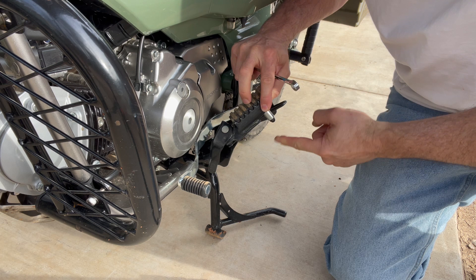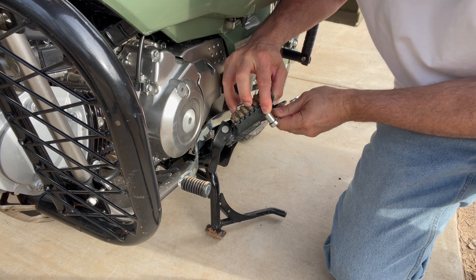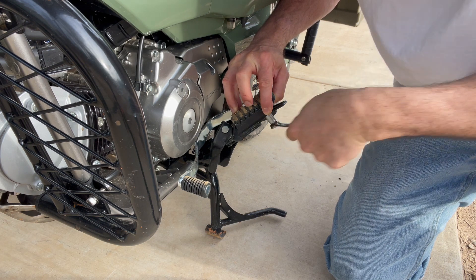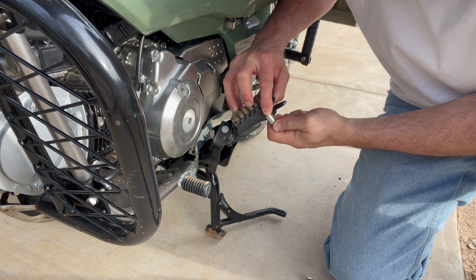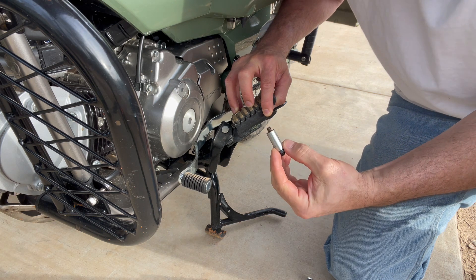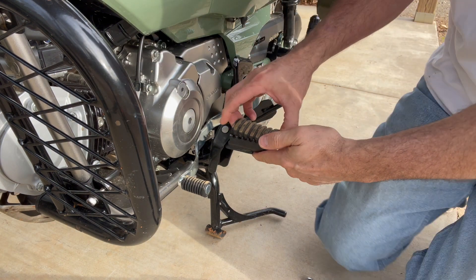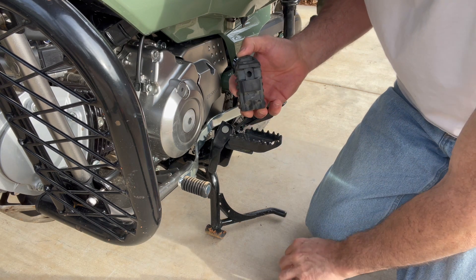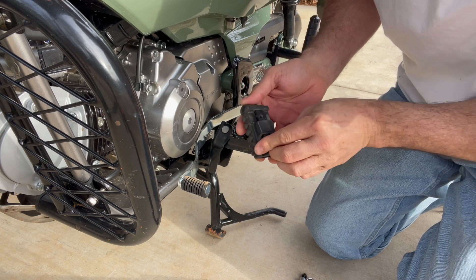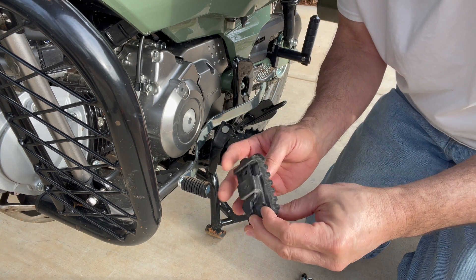What you're going to do is take this bolt — this is just the 10 millimeter — you're going to loosen this. This is under your pedal for your CT 125. Once you get it loose, you can almost get it by hand. It's got this sort of spacer, and I don't know what this is for, like why this peg goes so far down. Because what you're going to see is this insert for your pads comes right off on your bike. There's this little metal part — this all comes off, you don't need any of it from the original bike.